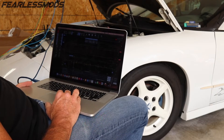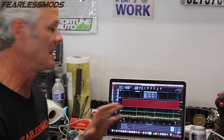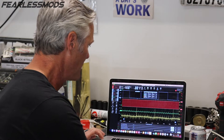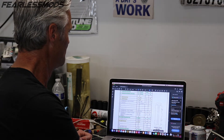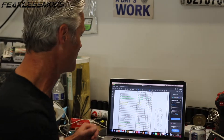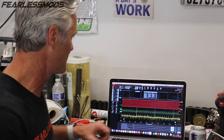So C is our ignition feed. I was definitely having some questions with regard to the ignition feed and the reference low signal, so I did pull up the service manual and look at that particular chart for the PCM connections. It just says that you should have eight-plus volts. I'm sitting right at battery voltage with the alternator charging at about 13.1 to 13.2 volts. Those little spikes are showing about a three-volt fluctuation — that can just be some noise in the system and nothing to concern ourselves with.